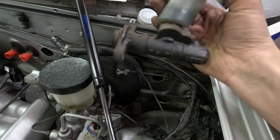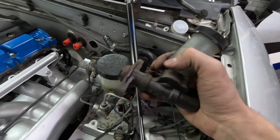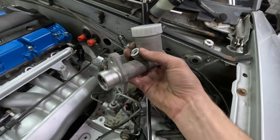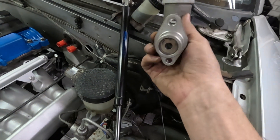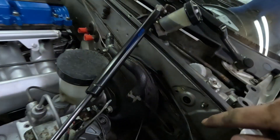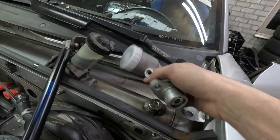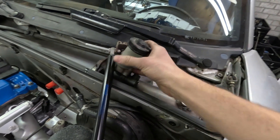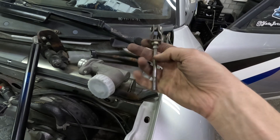For the clutch, this is the original Miata slave cylinder or master cylinder, and it has the wrong piston size for the BMW slave cylinder. So what we ended up choosing is to go with this Land Rover master cylinder, which is nice because it has an internal reservoir and is the same style with the flange and everything. Originally when you take off the master cylinder from the Miata you get this shaft which screws onto the pedal, and we're gonna make it fit with a little plate which Thais is making right now. It's basically going to be a plate that bolts up to this and makes two new studs, because the pattern on these is different — the Land Rover one is straight up and the original Miata one is at an angle — so we'll position it nicely and get it mounted up and can always adjust it and cut it to size.